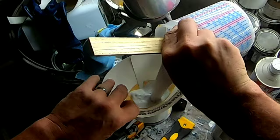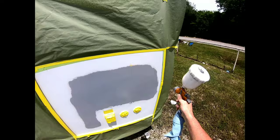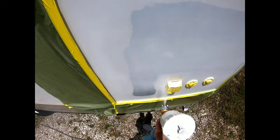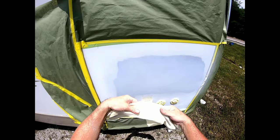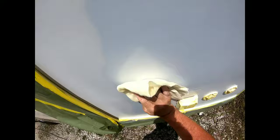Now I'm going to pour my paint into the gun — no need to clean out the adhesion promoter that's left in there, because that's just going to help. We're going to cover the primer first using long, nice, even strokes, overlapping about 60%. Actually, put a pretty light coat on first — just get it covered and wet, then let it flash off. This way, if there are any contaminants on the panel, they're less likely to react with less product on the surface, and it creates a base for your second, heavier coat.